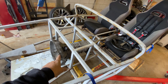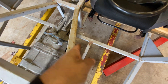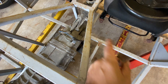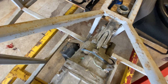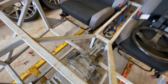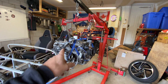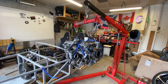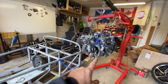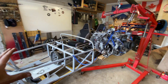I'm going to take my transmission out and get the mounts off of that as well. It's a fairly straightforward mount down there except my feet are going to be here, so I need to make a shorter mount. Again, this is not symmetrical — that one slopes up there, that one goes flat. I'm sure Mazda had a great plan for all this, but I'm going to have to modify. I don't like engines hanging off of hoists for longer than necessary, so I'll get that down and once all that mount stuff is off, I'll mate them together, because I'd like to be able to get the whole thing in in one go, rather than constantly having to take things apart.